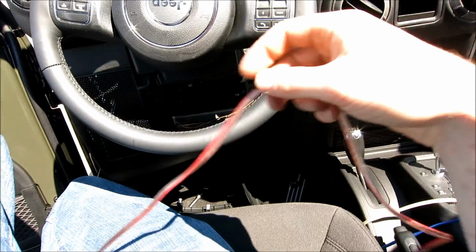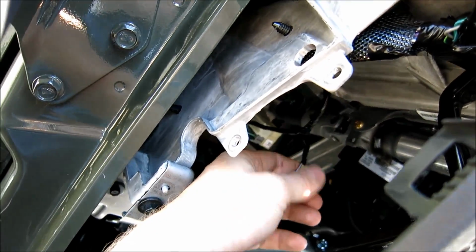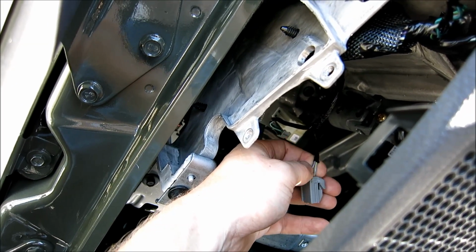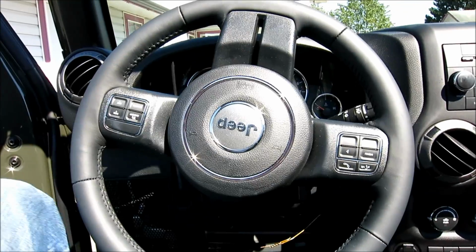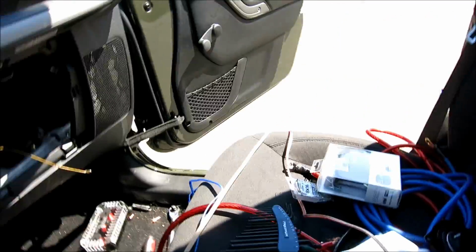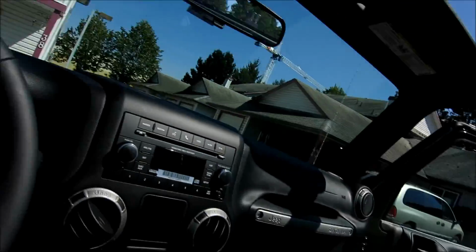Sorry, another one you're going to want to run through is a 3rd wire from there. The reason why is because even though you're doing 1 input wire, if you're adding a 4-channel amp, we need to solder one onto here, remember? So you are going to have to run that 2nd wire. So that way you can solder 1 onto here, because this is going to be the side that's coming from the deck, and then you're going to need 1 from your crossover to go back to the amplifier and the input. And I'll show you how that all works, because as you can see here, we have the line output converter, so you need to run a line from each one coming out of the deck,